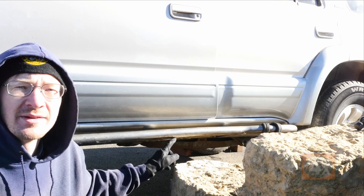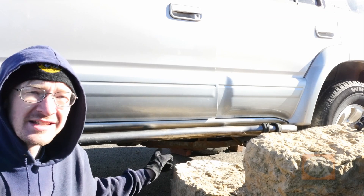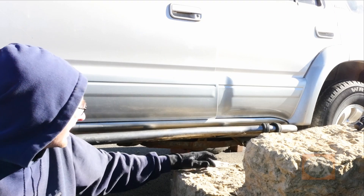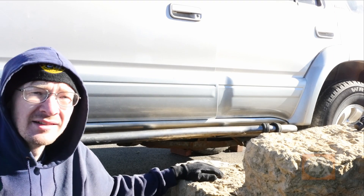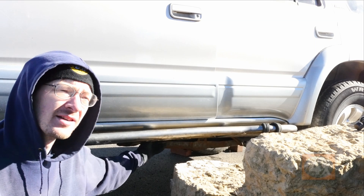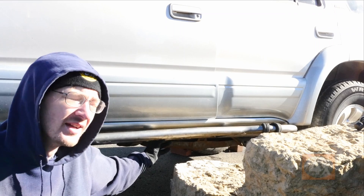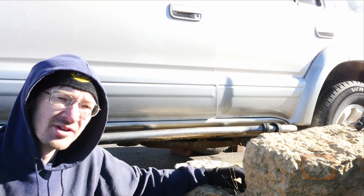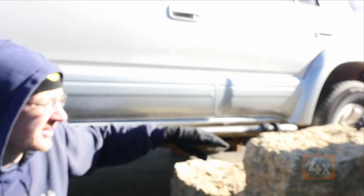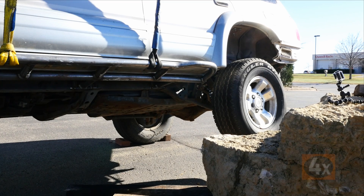Just did the 18-inch drop of the DOM slider onto the boulder — very long drop, very hard hit. It was enough to actually bounce the opposite side of the truck. Definitely not something that I would have wanted to be sitting in. But you can see that the slider got just a very slight bend to it on the outer tube. It was enough of a hit to flex the slider legs into the rocker split seam and dent the split seam, but it is not actually touching the split seam with no weight on the slider. So you're still not going to get rattles driving around with it. Still plenty of room to the door — you can see them opening it by the bottom of the door, front door, back door, same thing. Fender flare doesn't even touch.